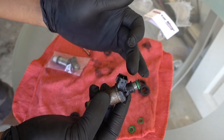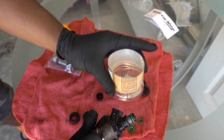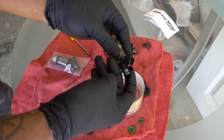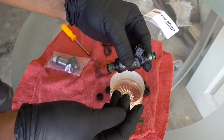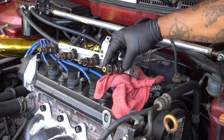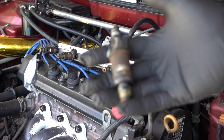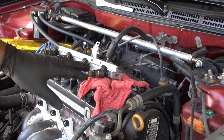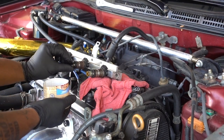This injector is ready. You can put a little bit of brand new engine oil around the O-rings so you have a good seal. In this case, if you don't have engine oil around, you can put a little bit of fuel on it so you don't have any leaks. Now that we have it like that, we can go and mount this one into the fuel rail. First fuel injector is ready and in place. Now we can remove the second one and do the same process. Once I get everything ready, I'm going to put it back on the car. Everything is being swapped — I'm going to put some fuel into the bottom of the rings so they go nice and easy when you put them back on.